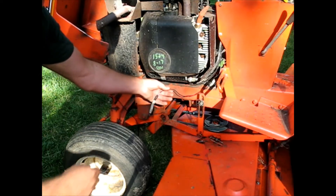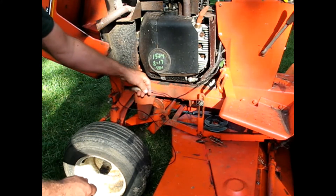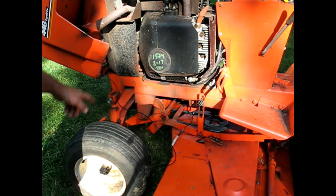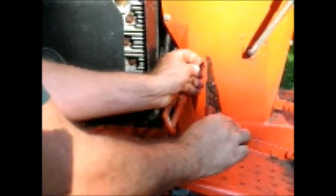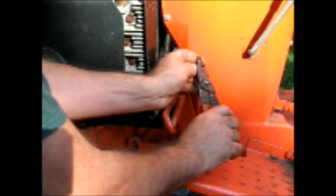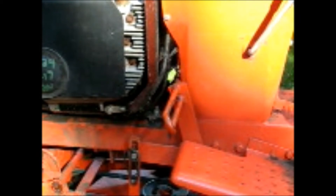Now we've got the one wire coming from this way and our new wire coming from this way. I just have to figure out where I want to splice it — do I want to cut it there or cut it up here? No going back now. In an ideal situation, if I was ready to pull this off and get to that ammeter job, I would go back to the source since I do have enough wire — that would be more reliable — but good enough. It's for the headlights, so if they didn't work I guess it wouldn't be the end of the world.